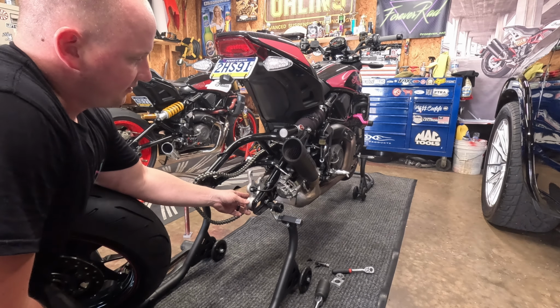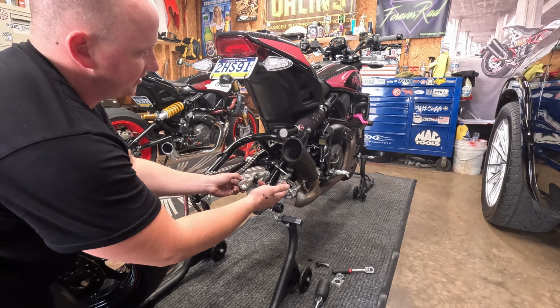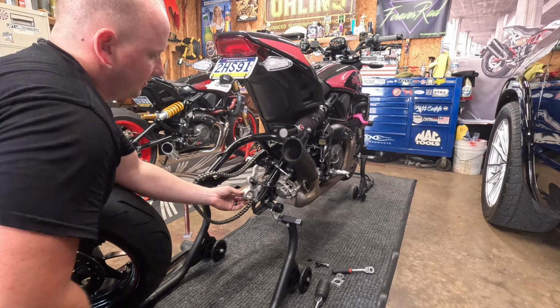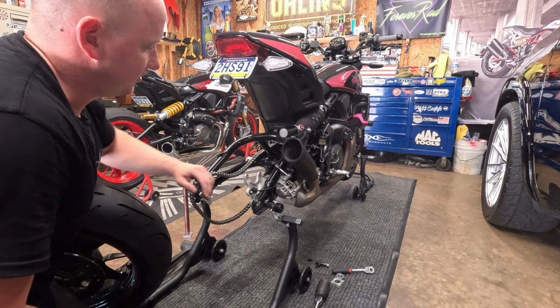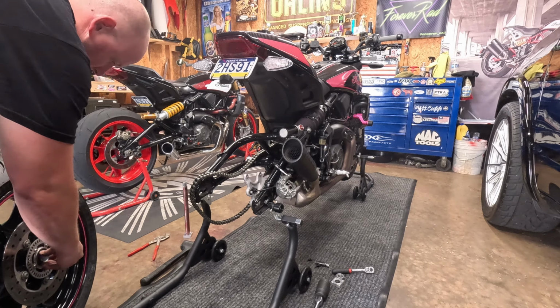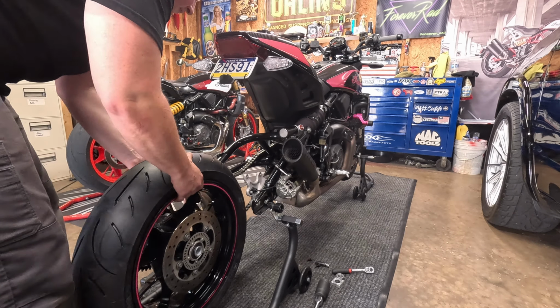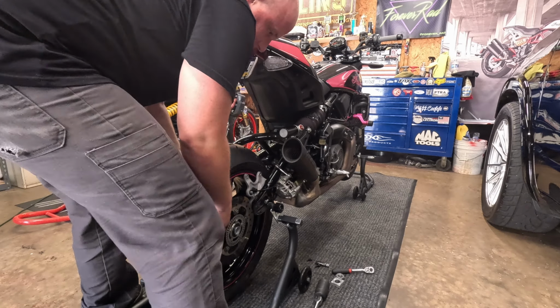So what happens then is, as soon as you hit your brake, this rotates, pulls out your ABS sensor, pulls out this, and just does a bunch of damage. So make sure that's in. That's why it's always a good idea to just take that off. So you got our spacer in, we're just gonna lift this up in, see how easy we can do it.